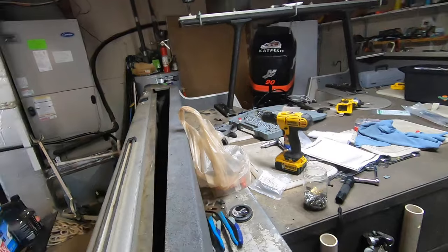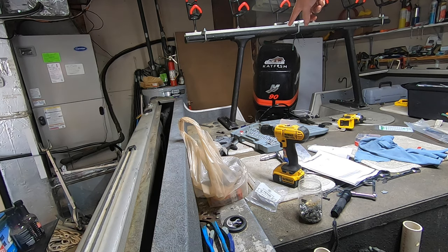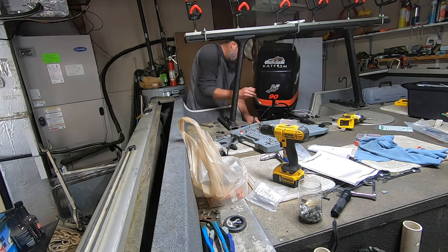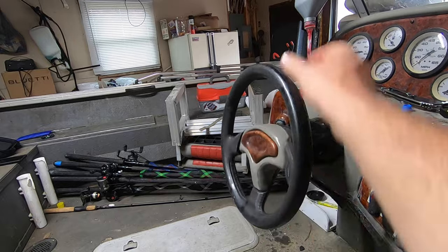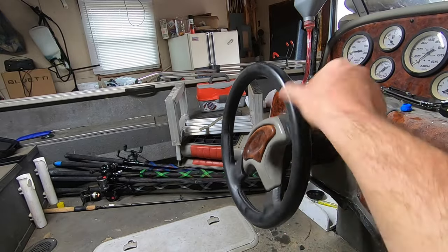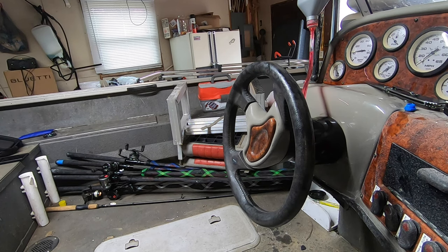All right, now you can see we got enough fluid to the back to where the motor turned like you're going to turn port side. So now we'll go back and we'll bleed the other screw the same way we did the first one. All right, now we're going to keep repeating these steps until all the bubbles are gone from the bleed line on both sides.